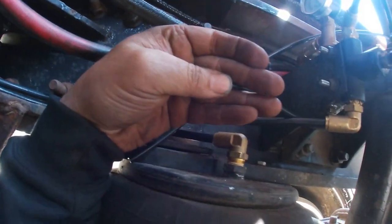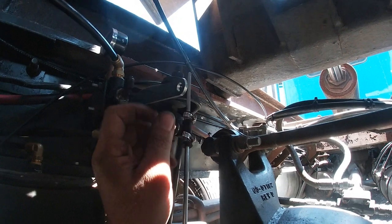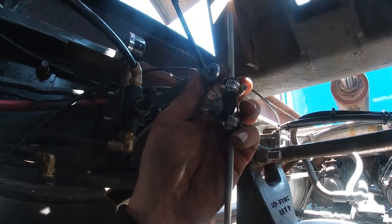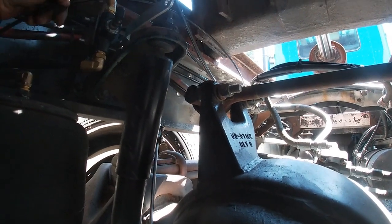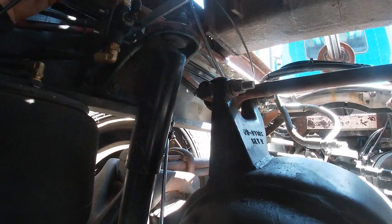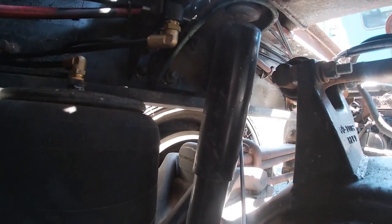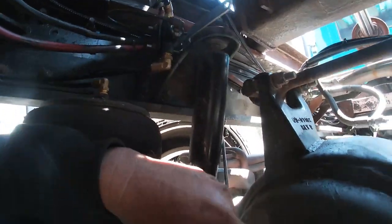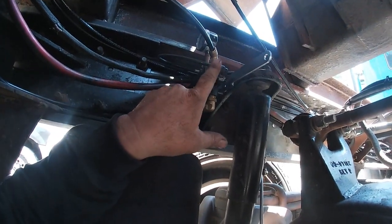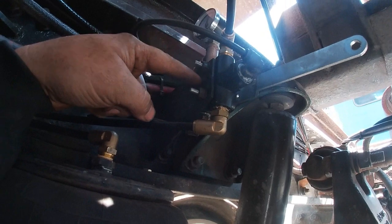See the little pigtail on the exhaust. When you put a load on, the rod senses the weight, the truck gets weighed down, and then it pumps the bags back up again. Now let me show you the dump valve in action. When you hit the dump switch on the dash, it puts air in here and pushes the plunger from here over to the dump valve.